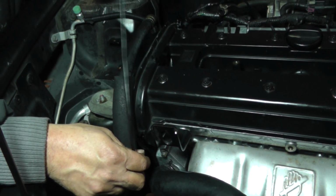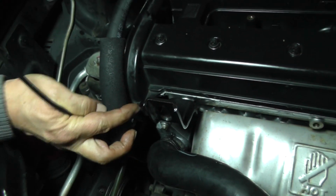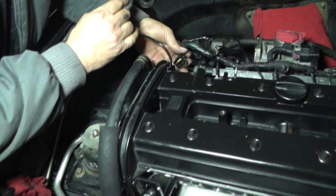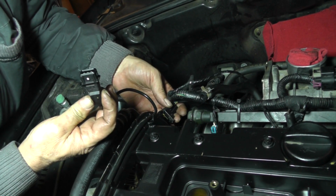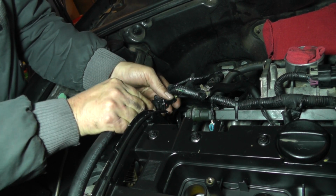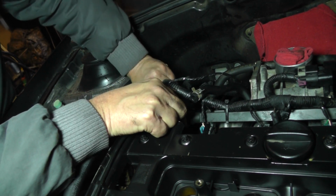Alright, let's take our crankshaft sensor cable here. Here's the little holders for it. There's one. It's one on the inside. Bring it up, snap it in, snap it in, snap it in. Okay. Now that one is going to go to this one right here. And he looks like he's going to go just like this. Okay. Now let's tuck him on down in there.